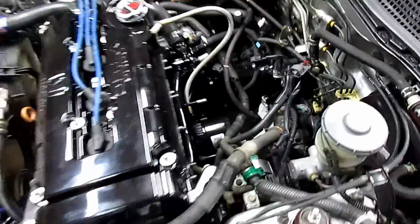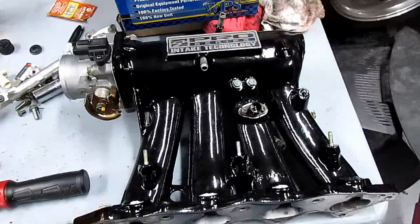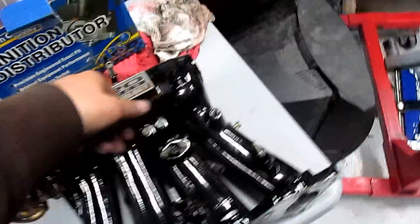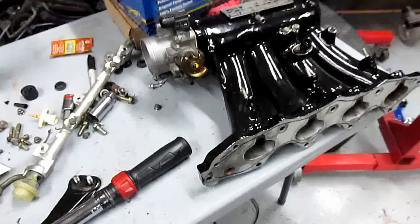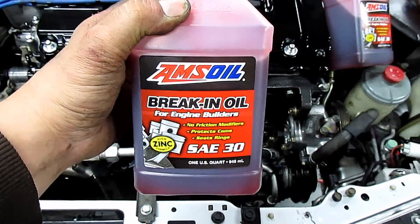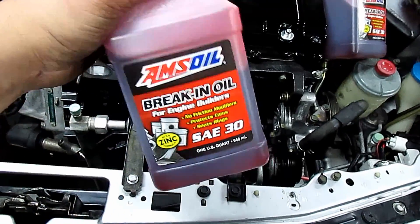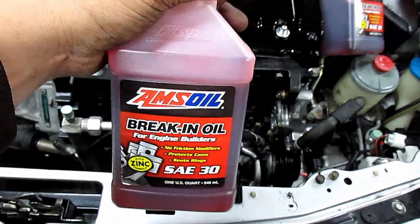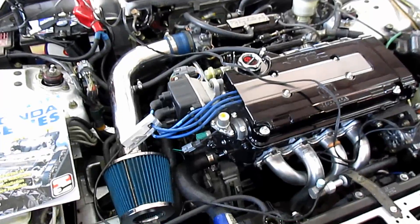Looks good, feeling good about it. Still need to put the intake in and we're missing small stuff like hose clamps for the back one. We're putting in AMSOIL break-in oil, SC SAE 30 — gonna run this for roughly 200 to 500 miles depending on how much he drives, then we'll swap over to the AMSOIL Z Rod.